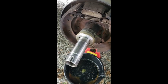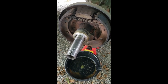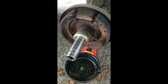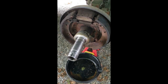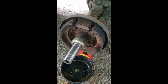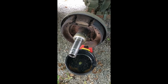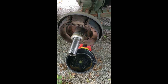But this is how they did it. If you talk to folks who have worked on these inflation systems, especially on Army trucks, they will probably say they are maintenance intensive because you have so many seals to replace. You've got to maintain the wheel valves and everything. There's a lot that goes into making sure the system doesn't leak air and deflate your tires or over-inflate them. Anyway, this is at least how the system works on the M35A3.